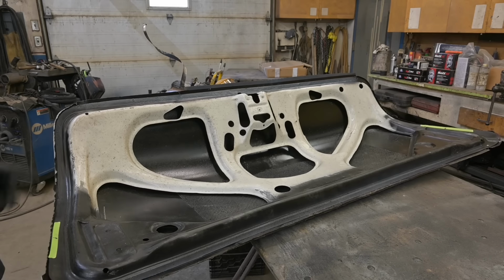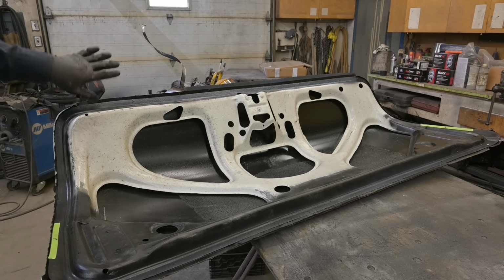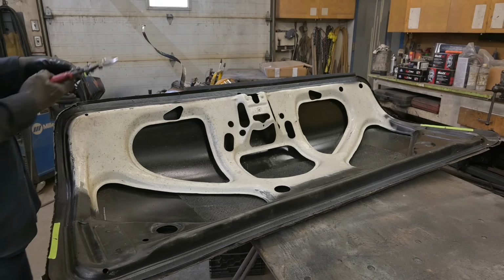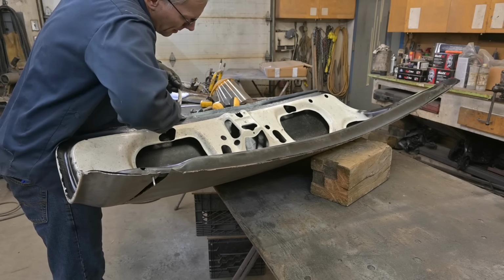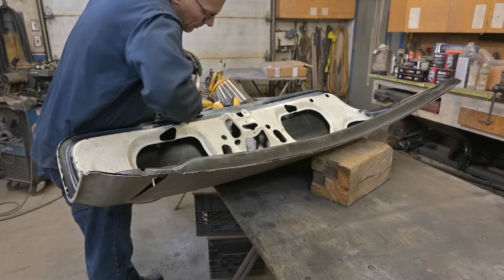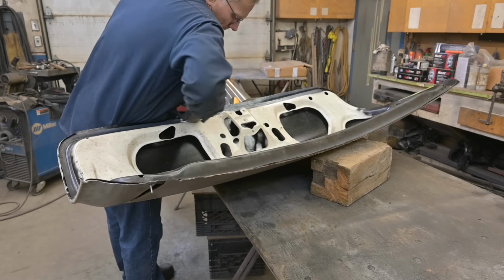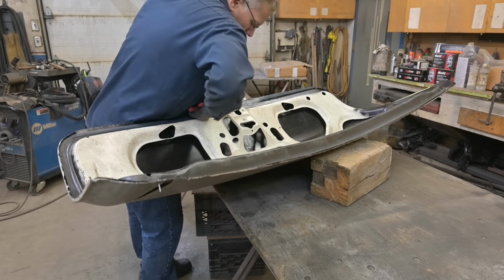Let's take a break. We're leaving this all together. I'm going to roll this over 90 degrees, maybe a bit more than 90, because that'll pop up into place, not a problem. I'd like to throw this up on the car and see how it looks. I'm not sure if this is obvious, but I think we're pretty much committed to putting in a couple little wedges and metal finishing that. It's a lot easier to roll a hem than weld 5.5 feet of panel.